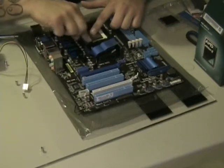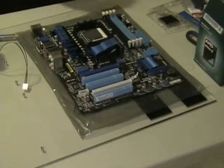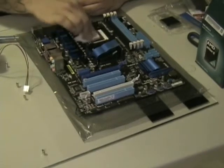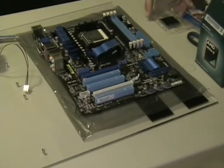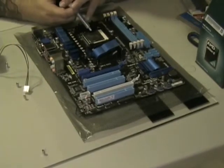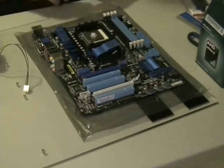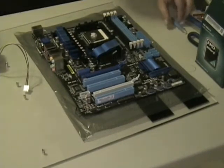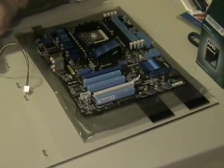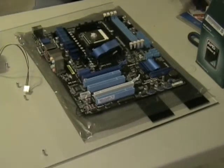Go ahead and get this locked down. Double-check, make sure everything's good and in place — it is. When you lock these down, you're going to feel quite a bit of resistance, which is okay, that's normal. Always make sure anytime your fingers have been around the back side of the processor, it's cleaned off nice with a chem pad — you don't want to get any oil in between there. It won't cool properly. A little bit of this paste goes a long way; you don't need to spread it. Get your blob on there, and whenever you anchor down your heat sink and fan, it's going to spread that paste and push it out so it's on a good, even cooling surface.